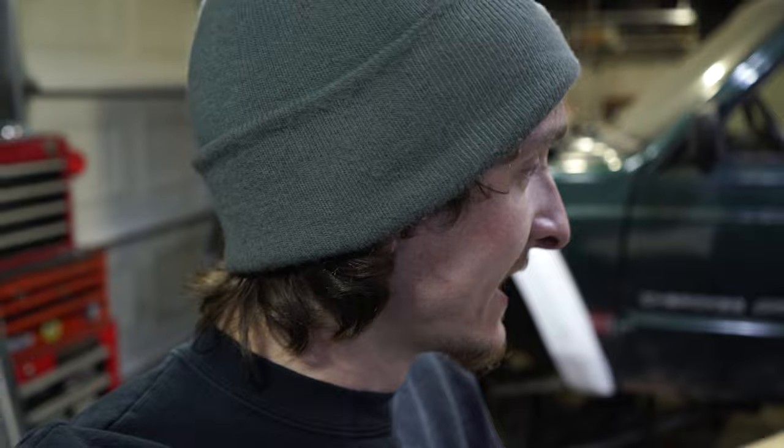So now it's time to install the coilovers into the Jeep and see if they're gonna work for this setup. We're gonna go ahead and set the preload to these coilovers. I think AccuTune, I gotta look at the email again, I think they recommended 1 inch of preload. So we're gonna go ahead and set that, get them in the Jeep and see what we're sitting at for the shaft showing at ride height.